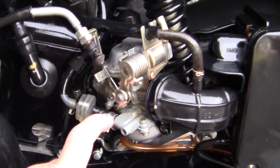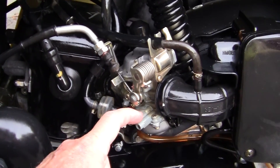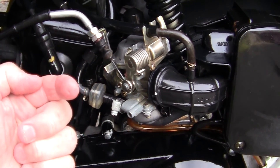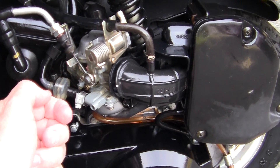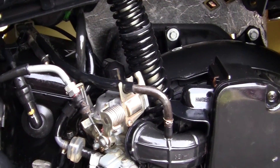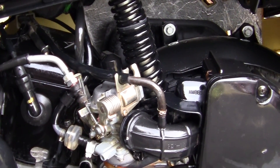Like your vent lines in your carburetor — you need your vent lines. If the gas goes into the float bowl, or petrol, it needs a hole to let the air out. And then when the gas goes down it needs a hole to let the air in, so it equalizes pressure. So that's just a good check: if it's been sitting a long time, check the vacuum lines, just blow through them, make sure they're fine.